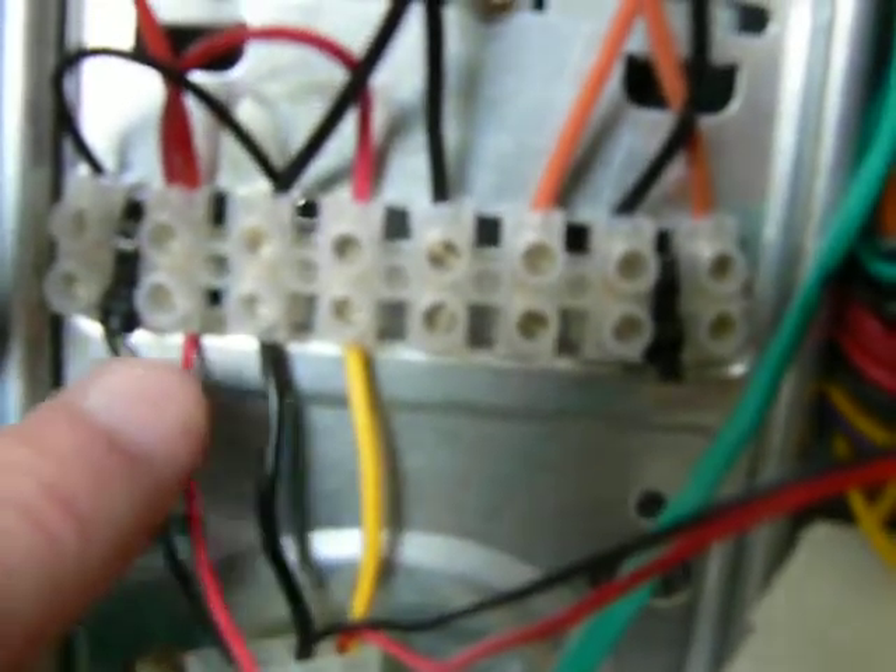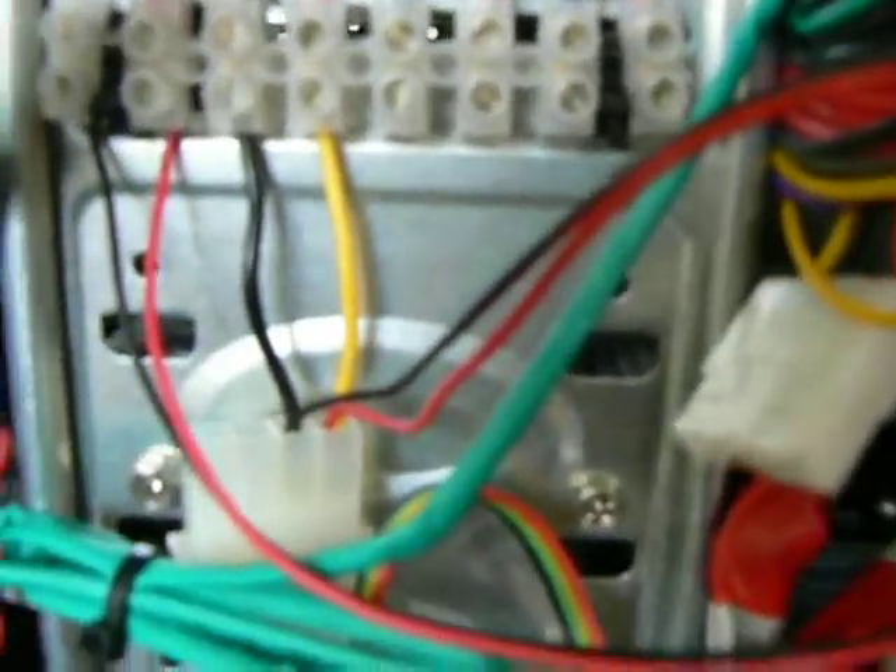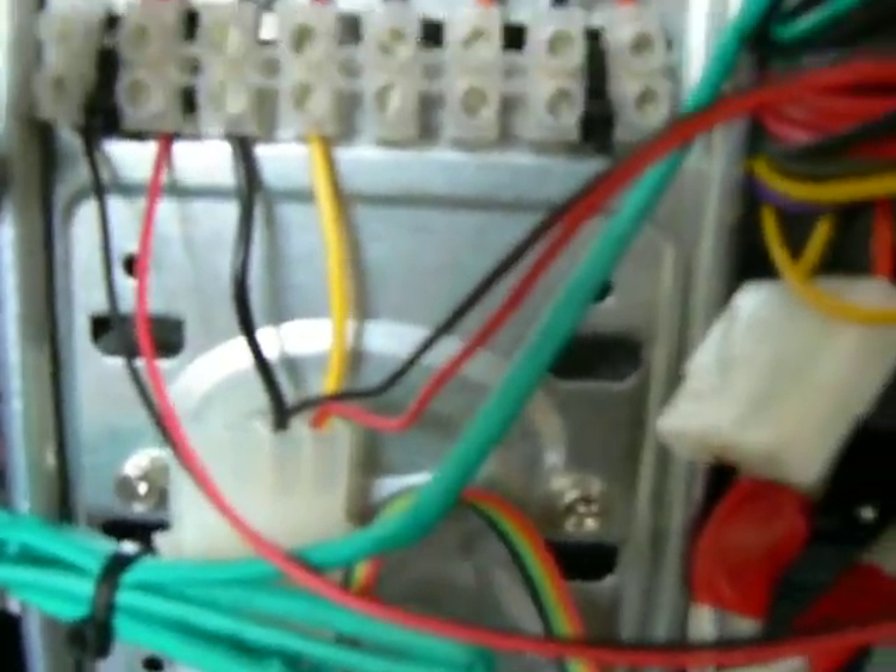At the moment I've got one fan connected up here, and this is actually connected to two fans. There's a molex pass-through here that connects out through this green cable to the large fan on the front, and also to the other fan on the back. I probably won't leave it connected up that way, but I've done that just to make sure that everything works — and it does work rather well.